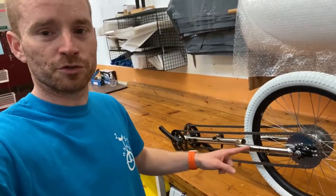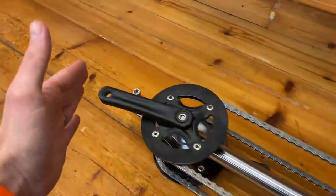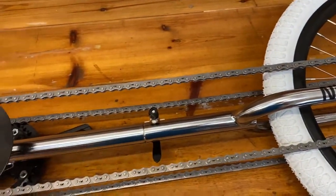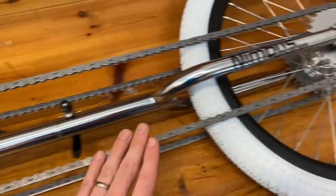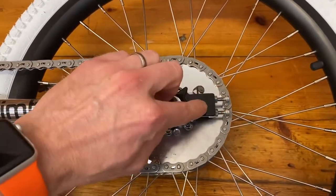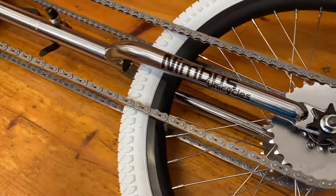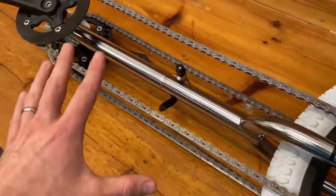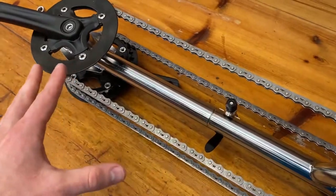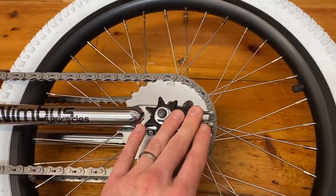The giraffe can then be put back together really quickly. I've got most of the giraffe - the important bit - on the bench. Here's the giraffe we're talking about. I don't have the top section, the seat post, and the saddle, but that's not relevant. We're talking about the chains and the chain tensioners. You saw in the last video that when tensioning the chain, we set up these two little bolts and tightened up these two little lock nuts with the spanner. This giraffe is actually designed to be taken apart and traveled with - that's why it's in sections, so it can go in a small suitcase. These chain tensioners actually help with that.